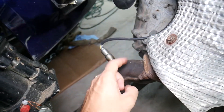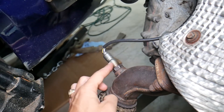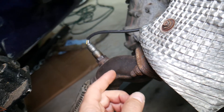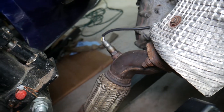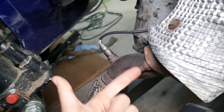On the back side of your Hyundai Sonata engine you'll notice the exhaust system. On the exhaust system there is one upstream oxygen sensor, also known as bank one sensor one or lambda sensor. It detects how much fuel and air remain in the exhaust, calculates it, and sends the information to the engine computer. The computer then determines if you have a lean or rich fuel mixture and makes adjustments to fuel, air, variable timing, and ignition to balance the mixture for clean, powerful combustion.